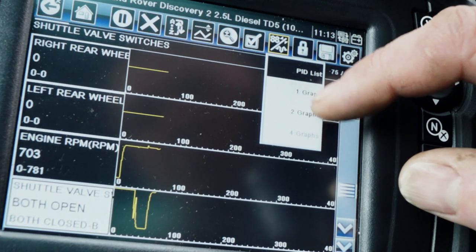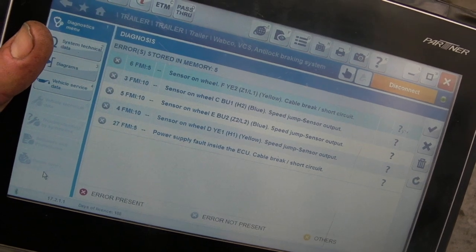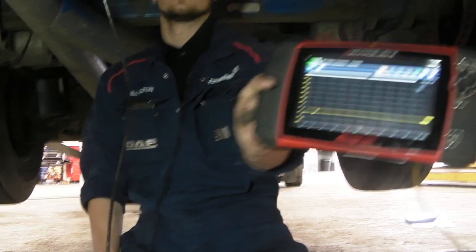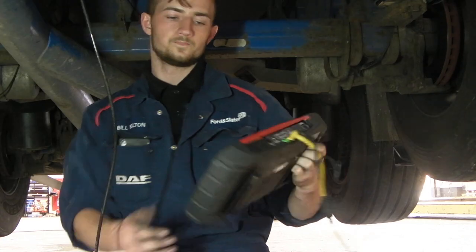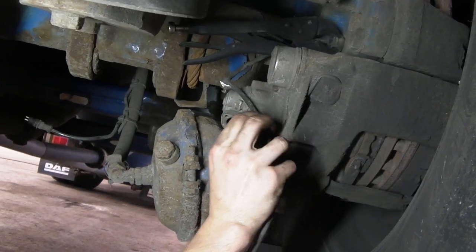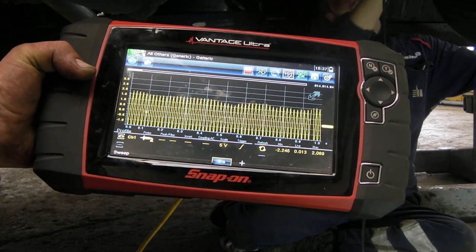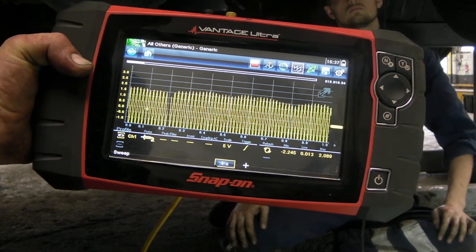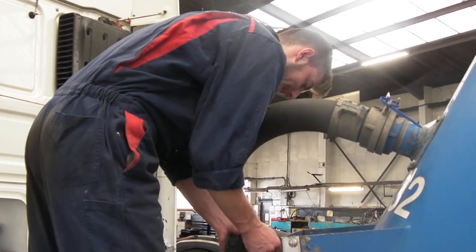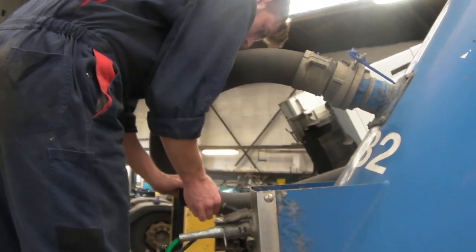However, if a wheel sensor is not working, it will give you issues because that's a piece of the puzzle that all the others can't read, and it will throw up a fault code. Getting back to our trailer — I think some of you have probably watched the video about the oscilloscope. We found a flat liner — no signal from the sensor. Found that the cable had been smashed, the sensor cable was changed, and we got a good signal. I'm always using an oscilloscope because it provides a hell of a lot of information quickly. The plug socket at the front was the power supply problem — changed that, it was just corroded pins.